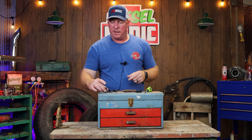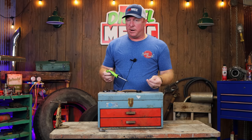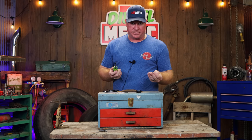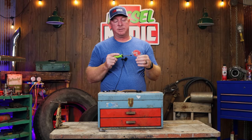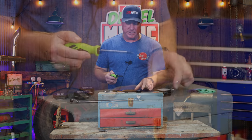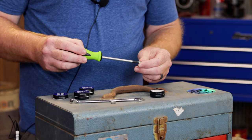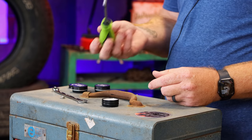Now that is exactly what this is designed to do. And what's cool — same way with a screwdriver. We've all been there where you're trying to use a cabinet screwdriver to reach up under a dash and get a blend door screw or something, you got to put it back in, and the thing always falls off. That's when we start cussing and getting aggravated. If you magnetize it, there's always a metal bracket in the way and the tip of the screw is always going to want to grab the bracket. You can simply take your Nut Wax, put a little bit on the tip of your screwdriver, stick it right in there, and she's going to hold like she's supposed to.